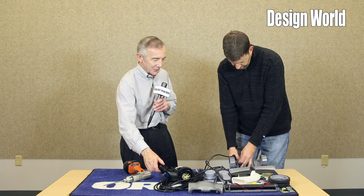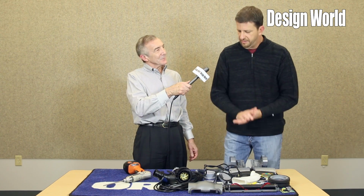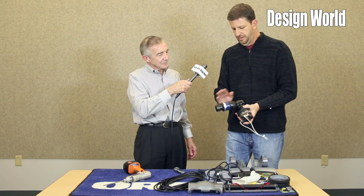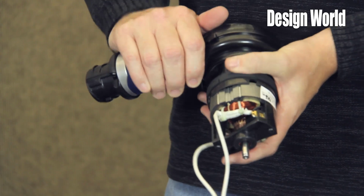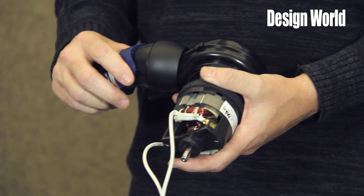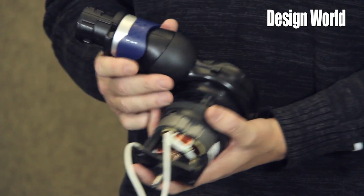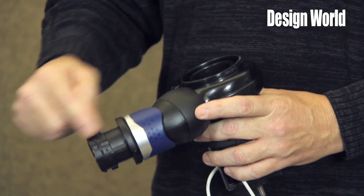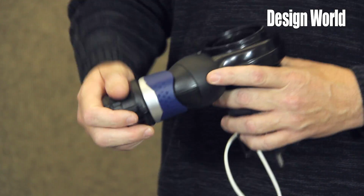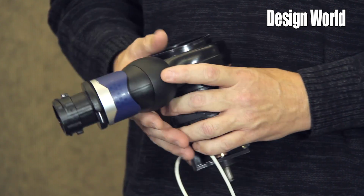Now, also, your pivot is also pivoting. You're pivoting the air path. Did you have to do anything special to seal that? We do have two seals within the steering knuckle. They are impregnated with a special lubricant to help smooth activation, to help keep debris out, and help keep the air path continuous all the way up. A lot of work went into this shape to try to minimize losses. Of course, with air path, anytime you have a turn, you have some loss, but we try to minimize it with our CFD design.